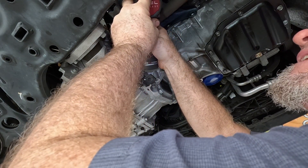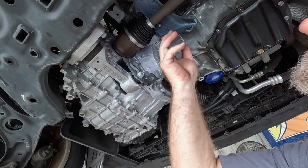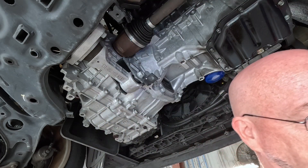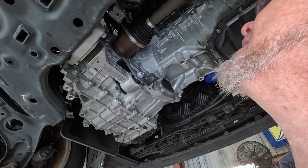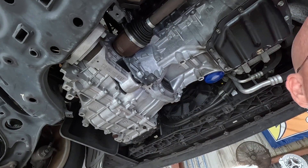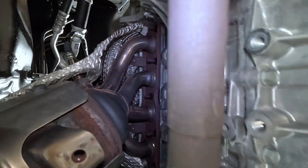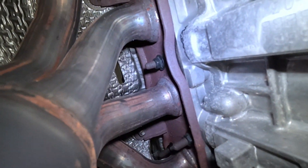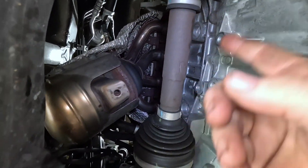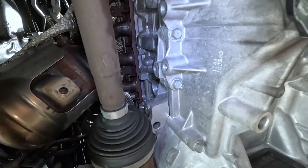Things have slowed down a little bit today. Luckily, this cat arrived early because I was just about to start playing with the project truck and they said your cat's here, which is cool. Get this done — it'll take an hour or two probably. I'm going to get some of these bolts on the exhaust manifold from underneath because it's easier. Then after I take the heat shield off from up top, I'll just have a few more left up top and I should be able to lift the cat out towards the hood.